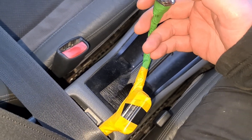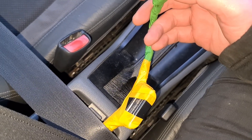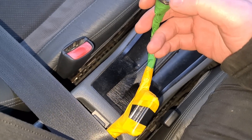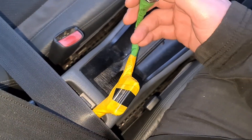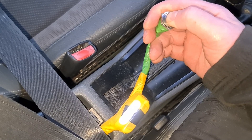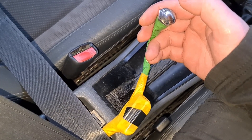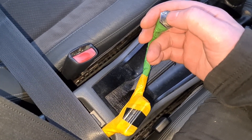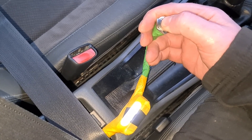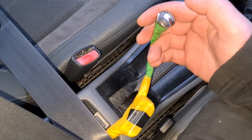That's the same as the first one, which means we've gone round — we've got past all of them. I don't know which ones are old, new, current, or just stored. Now that we've read them all, I'm going to hold the button down for seven seconds — one, two, three, four, five, six, seven — then the light should come on by itself. It flashed: one, two, three, four, five, six, seven.